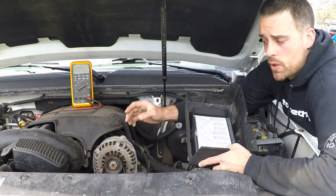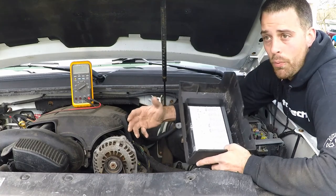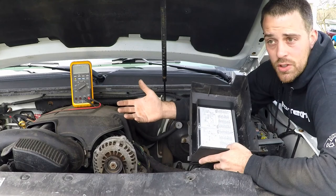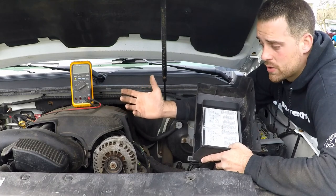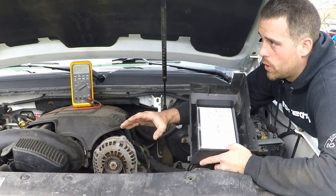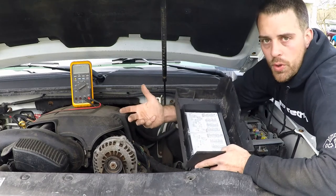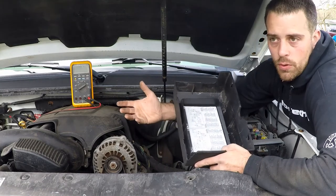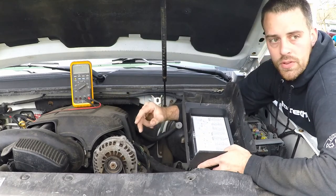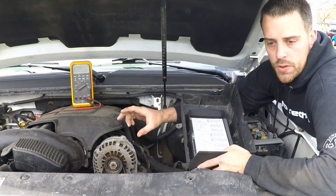So I hope this video was informative. I hope that we talked about some of the details about what we need to look for. Some of that is related to basic maintenance, like checking belts and tensioners. But other things, like just understanding how you can check this without buying a full VAT 40, or maybe your vehicle's stranded and you can't get it to AutoZone where they offer free battery tests. I don't know what your circumstance is, but this is a quick and easy way of using just a basic voltmeter to check for starter or alternator health.